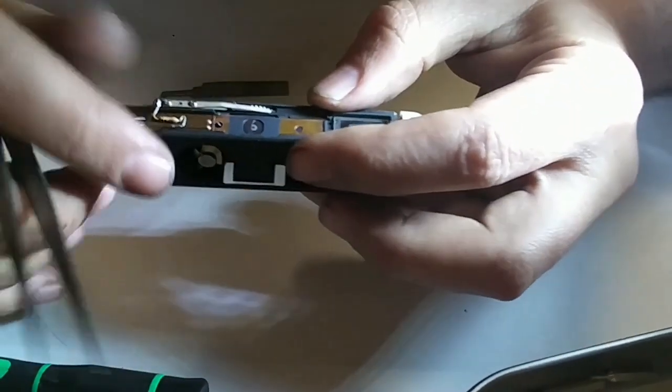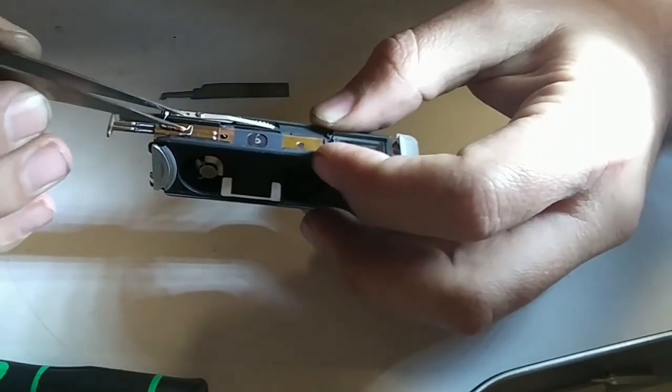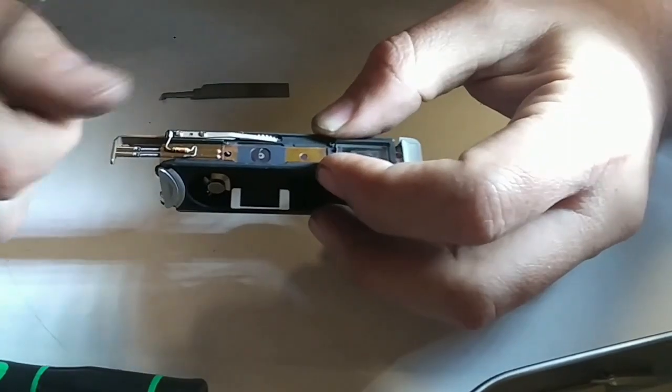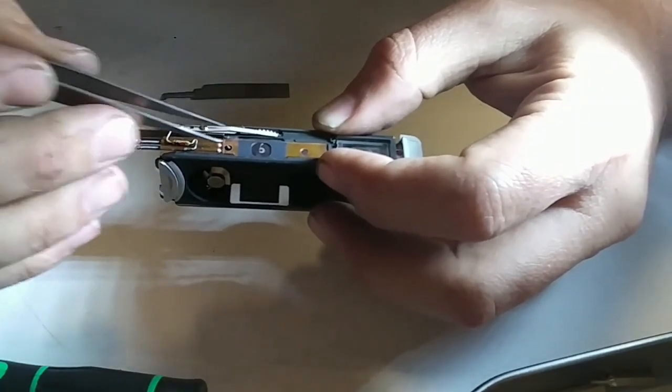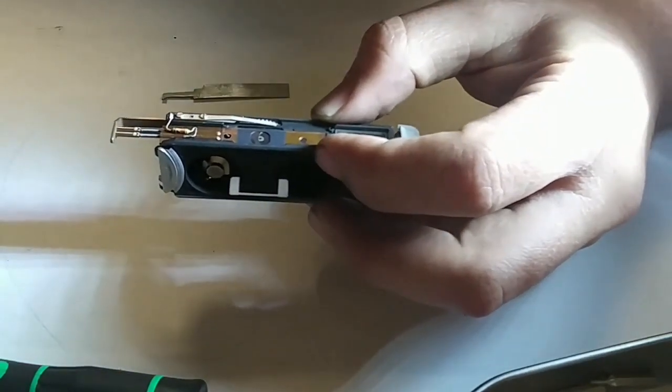The stories I've heard is when these blades are sliding back and forth, if something goes wrong, you take this arm here and you mash it in, and they just get crumpled into nothing. And that seems to be the case on this thing. So this needs new shutter blades.